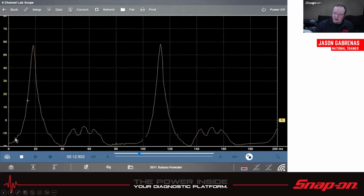So we can see as the piston climbs up, it is going to increase compression in the cylinder and pressure in the cylinder. Somewhere before top dead center, we are going to have an ignition event. It gets to top dead center, and then it gets blown back down. And as it goes back down, it's going to go down eventually, creating a vacuum pocket. And then we'll have some valve overlap here. And then we'll have the exhaust. In this case, it's a 4-cylinder engine. This is one of the cylinders, and then those are the other 3 cylinders we can see in the exhaust.